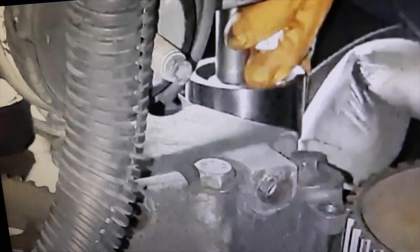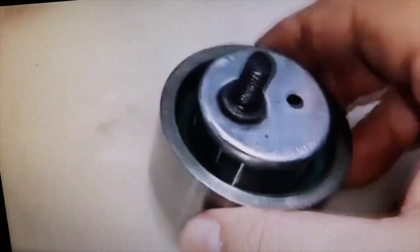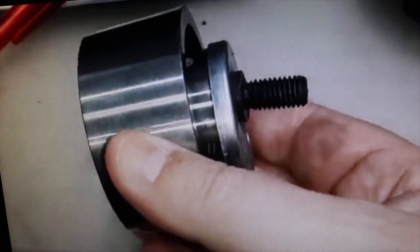The problem here is that the screw that has been bent is a separator screw. That screw, theoretically, is never changed and it does not come with the distribution kit. There you can clearly see the bent screw. This bent screw cannot be put back. It is screwed to the block, and the screw that you see on the left is screwed to this spacer screw.